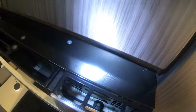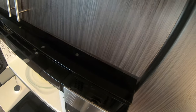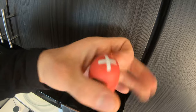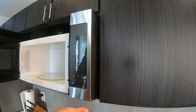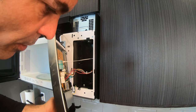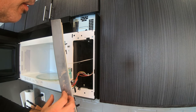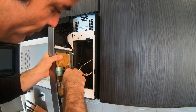You're going to want the door open, and then on the top right of the panel there is a Phillips head screw — go ahead and unscrew that. Once you have that screw loose, you're going to want to push up on the control panel. One of the hooks broke, but as you can see these latches latch into these holes right here. First thing I do is start unplugging everything — it's not too hard to line up the plugs.